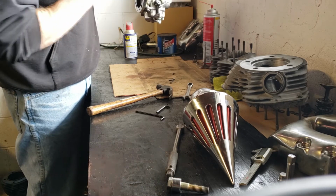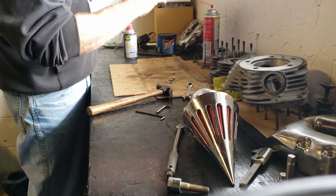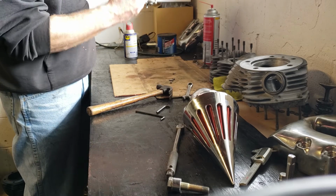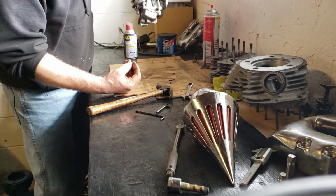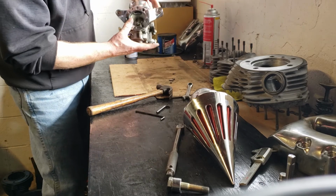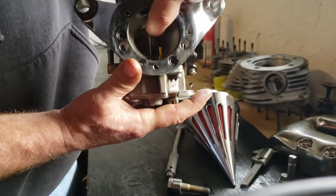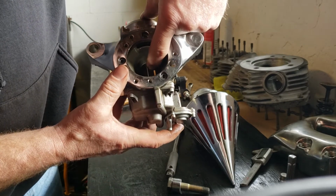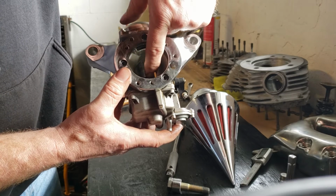it pumps a little squirt of gas in there. Under normal conditions, once you do that, then your throttle's held open. This pump doesn't do anything at that point. The vacuum or the suction, the intake of the engine, is then what's drawing the fuel out of the bowl in there. And you can see inside of here, I don't know if you can or not, but there is a little needle going down into a hole, and that's what meters the fuel.